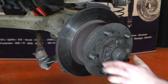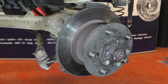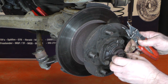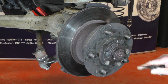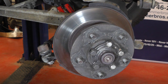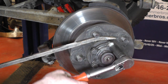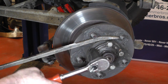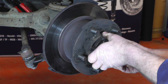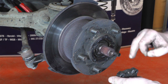Now time to remove the disc. Firstly we're going to remove the drive flange - get a screwdriver and prise the rubber cap off the front, then take the circlip off the drive shaft. Be careful not to drop the washer; get that off, take the shims off, and then take the four or five 17mm bolts out. Hopefully we'll be able to pull the drive flange off the drive shaft. If you haven't got an impact gun, put a bar against the wheel stud so it holds the hub while you crack all five bolts off. Sometimes the drive flange gets really tight and seizes onto the splines and we've had times where we've had to cut them off.